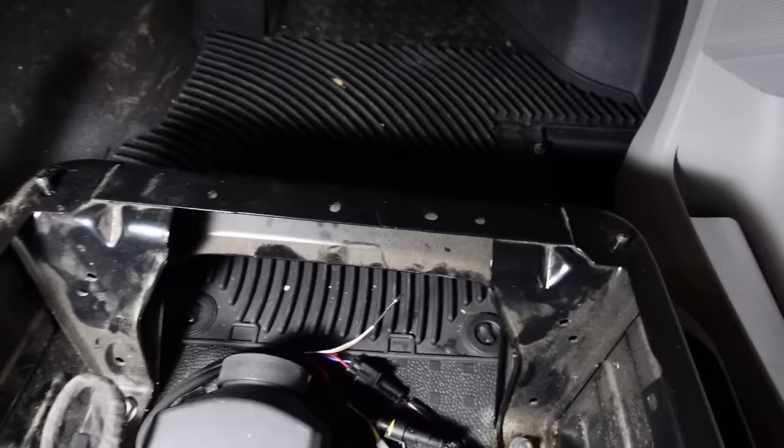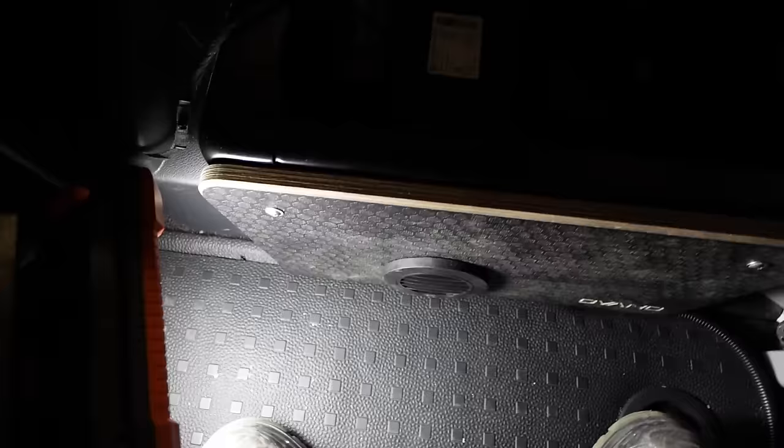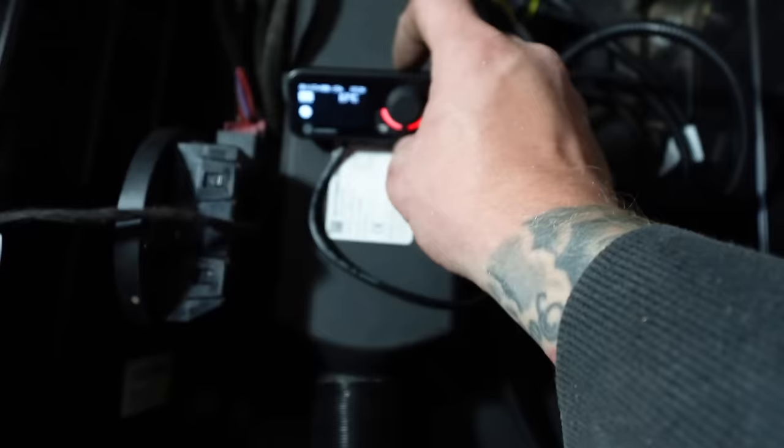On my installation, the diesel heater takes its air intake because the front of the seat box is totally open - that is how it sucks in recirculated warm air. A couple of inches of hose go from the diesel heater into one of the vents supplied with the small van kit, also called a transporter kit. A common mistake: people believe the outlet hose on the heat output requires a jubilee clip - it doesn't. Even if the unit is installed externally, do not put a jubilee clip around the air intake or the hot air output, as it increases the chances of moving the casing and causing the fan to hit the edge of the case.